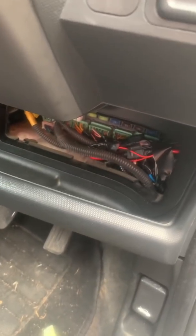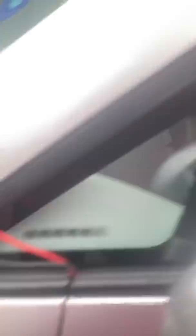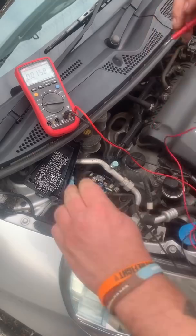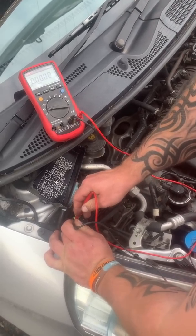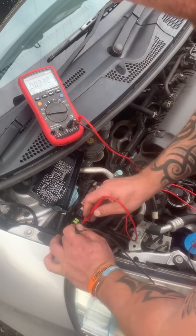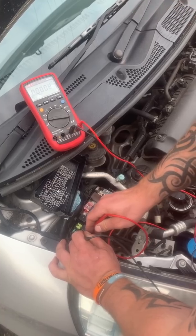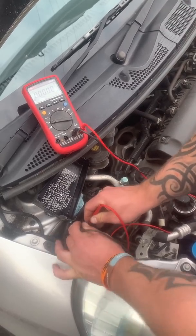What we've done, to make it easier, is move this trim panel back and just disconnected the door striker switch, so the car can go to sleep as normal. Then we're going to go through and do a voltage drop test over all the fuses. Just to confirm - you can see the door is ajar slightly with the lock on - we're still back to where we were, the car has gone to sleep at 68 milliamps. We pull our probes across like this and we're measuring the voltage drop across each fuse in turn, all we're looking for is millivolts.